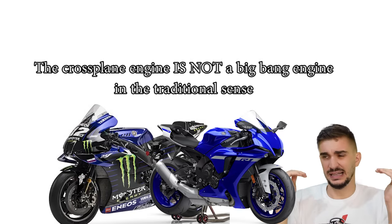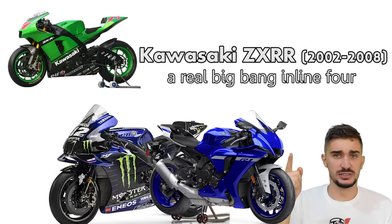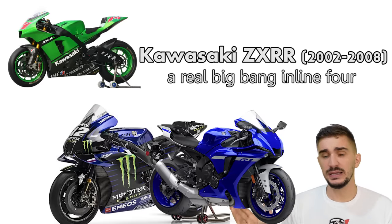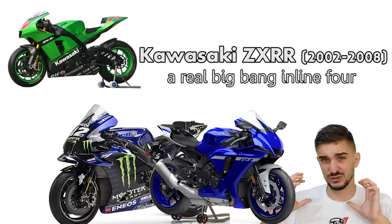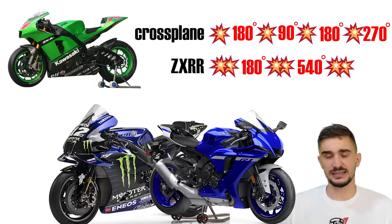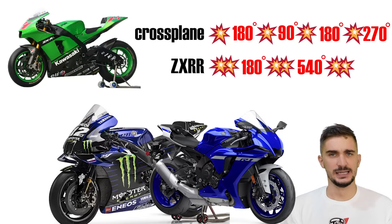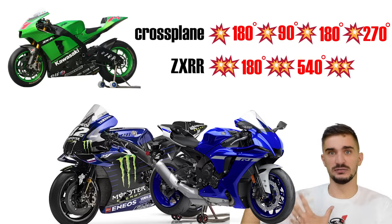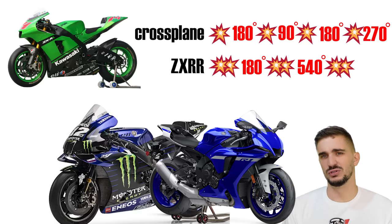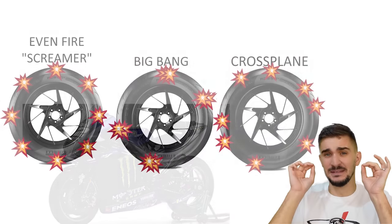Now, many people also call the Yamaha R1 engine a big bang engine, but it isn't a big bang engine in the real traditional sense of the word. An example of that is the Kawasaki ZX-RR race from 2002 to 2008 in the MotoGP. It's also an inline four, but it's constructed to fire two cylinders almost simultaneously and then rotate a lot and then fire the other two cylinders. And as you can see, its firing interval looks a lot more absurd than the firing interval of the Yamaha R1. And it's miles away from the even firing interval of screamer engines.